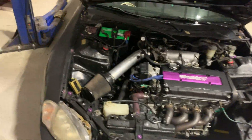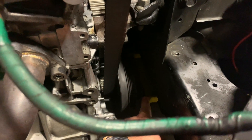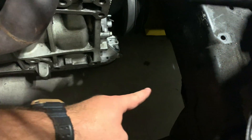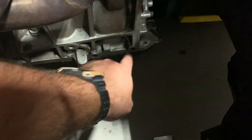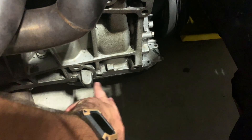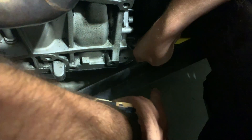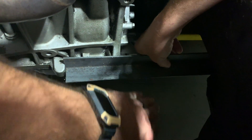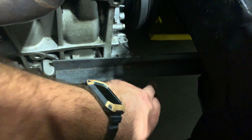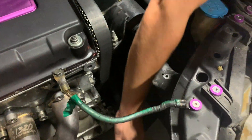The first thing — probably the hardest part — is figuring out how to mount this thing. Off of this far rib, it's going to go down through here. We've got these two holes here — hopefully we can bolt into them. If we can bolt across through here with a 90-degree L-bracket, we can go over here and cut wherever we need to, and the other part of the 90-L will lay in here. We'll weld this together, bolt it here, bolt to the supercharger out here, and then off of one of these bolts we'll run a hinge joint to make it actually pivot.